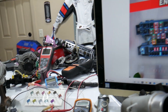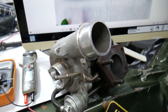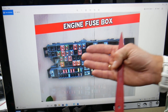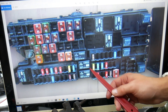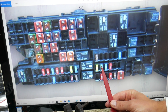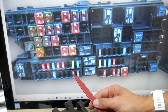You'll need to check multiple fuses because they control the engine functions. If you have problems with the turbo, turbo solenoid, wastegate actuator solenoid, or anything like that, check these fuses. In this row, you need to check fuse 67, 68, 69, and 70, then check fuse 86, and then fuse number 90.